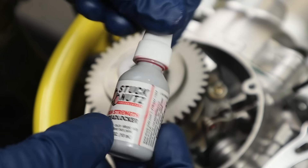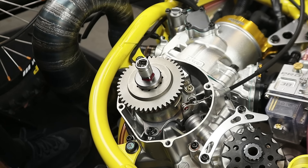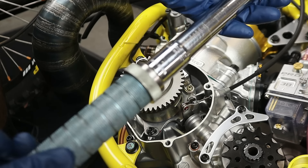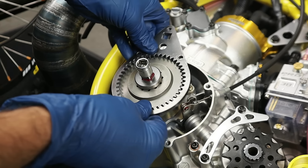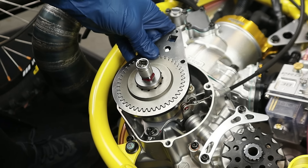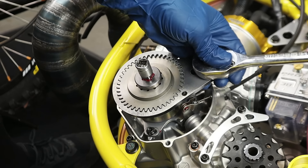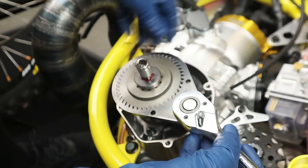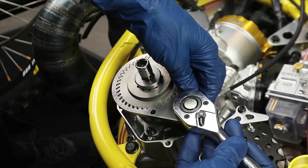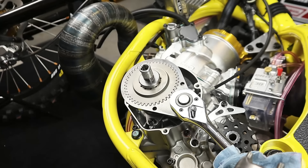Next up, drop our half-inch adapter in there and set torque with the torque wrench — I'm set at 42 foot-pounds; the manual calls for 40, a little extra won't kill us. We also have the special tool from Panthera that holds the drive gear while we torque. I'll let this thing fly down, rest on my foot peg so I can set torque and have both hands free. That's a nice sturdy tool they made.